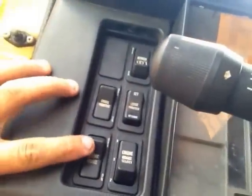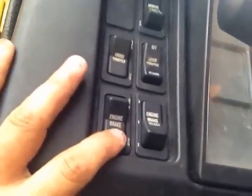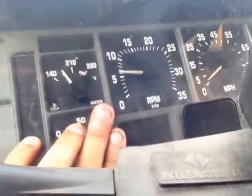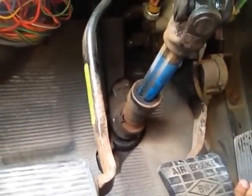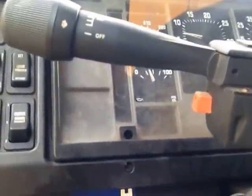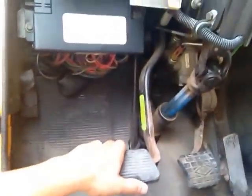So in the next video we'll go over that. Again, you just want to shut off the engine brake — just shut it off. The engine brake only comes on when this switch is on. We have a safety on these newer trucks, so it's not going to kick on at idle. Say you're going down the road, holding speed, engine brake is on — then you let up the throttle, it kicks in. The RPMs drop very quickly when the engine brake is on because you're taking the power cycle of the engine and just dumping it out of the exhaust.